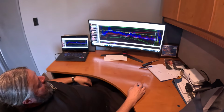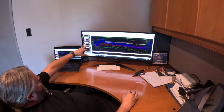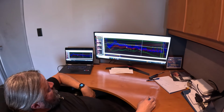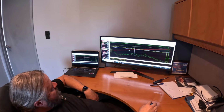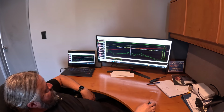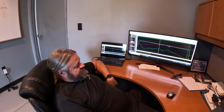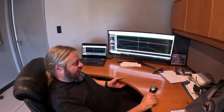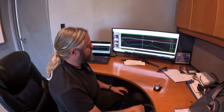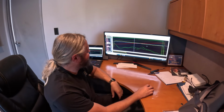So with the filter, we're just down a little bit of boost. If you grab any spot, like right here, we're down 0.6 of a pound. So just pretty much the whole way. The yellow line is boost, and the one we just made is the solid yellow, and it's just down a little bit. And that corresponds with our little bit of power loss. So thinking removing that filter, we'll be right back where we were yesterday? I would assume so. Only one way to find out, but probably so. And then the next move is change more parts? Yeah, change more parts, till we find parts that work. We'll get it figured out.